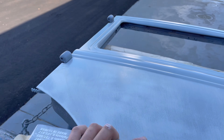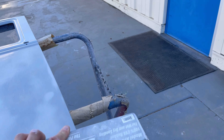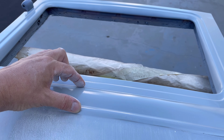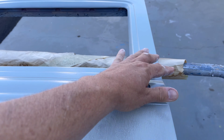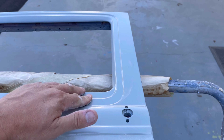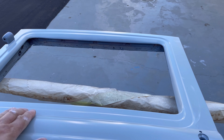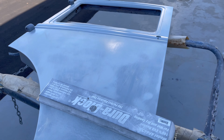Then I'll do 180, and then I'll go ahead and reapply the high build. I'm not going to worry about working on the belt line today — I'm just going to tape that off and leave the tape up so I don't make a tape line. Up here I'll do the flats, but these pieces around the window and the belt line are already very nice, so I don't need to build a lot of primer in there.